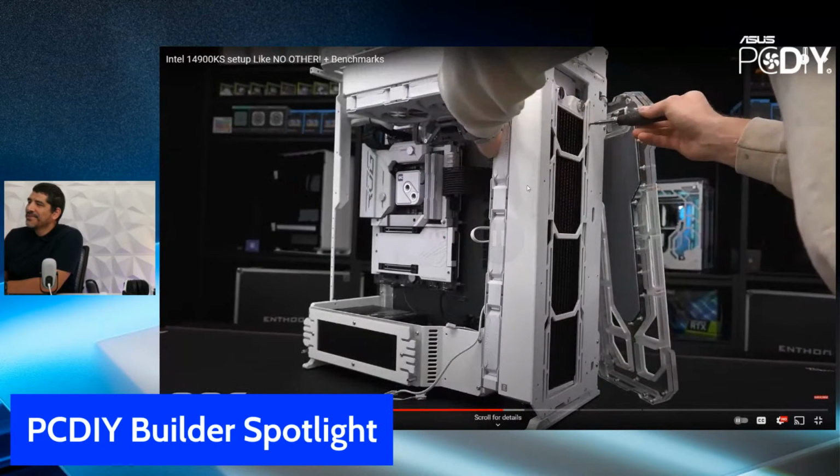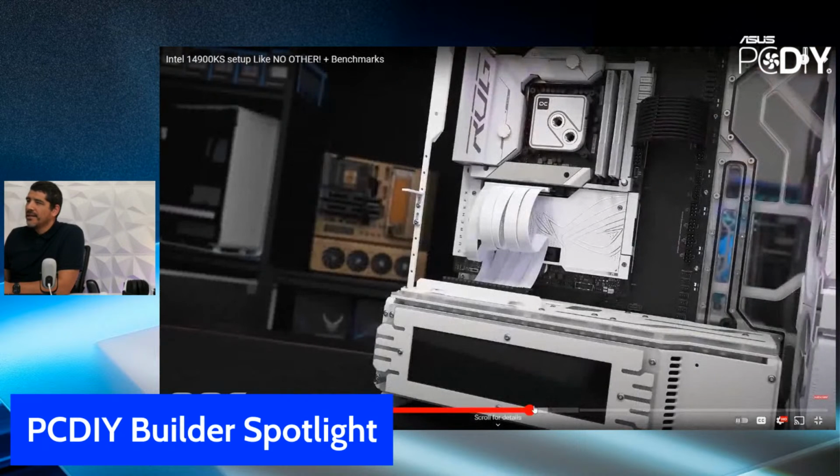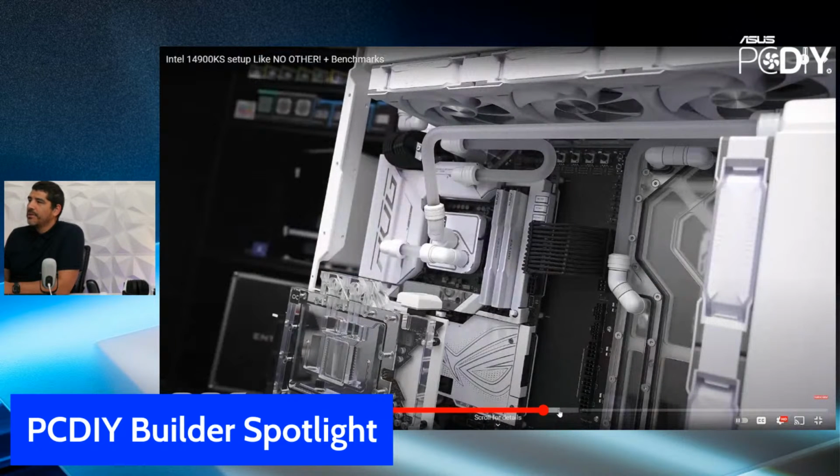Look at those super thick rads. Absolutely beastly rads, right? Just super thick. Of course, it makes sense that you would also go with the larger base fans, something like what he's doing here with, I think these are the T30s from Phanteks, because of course with such a thick radiator, you want to make sure you have sufficient static pressure performance to effectively utilize that, because you don't want underpowered fans. A lot of the time, ARGB fans are going to be underperforming compared to traditional fans.